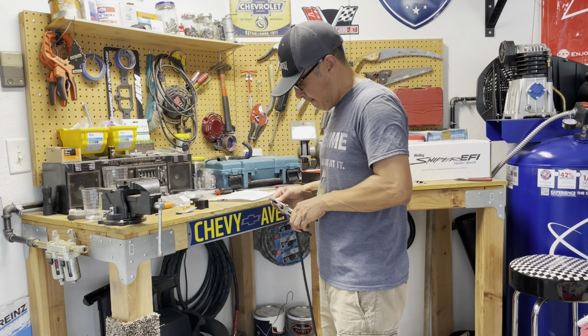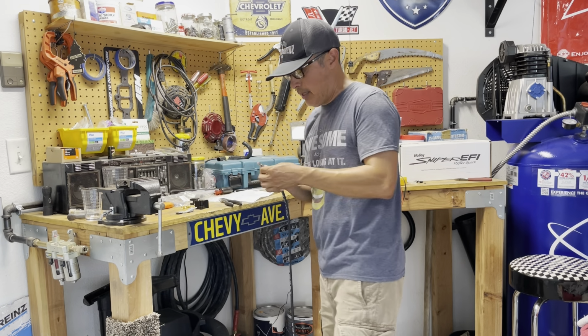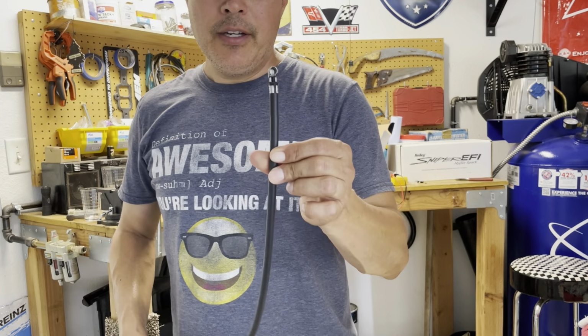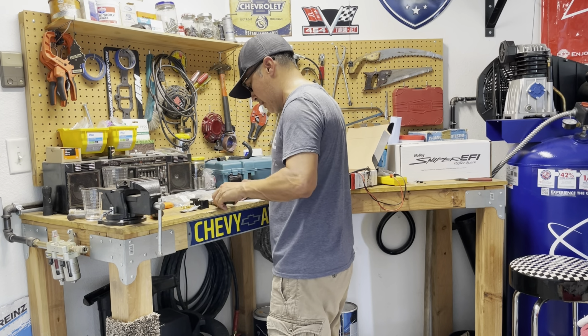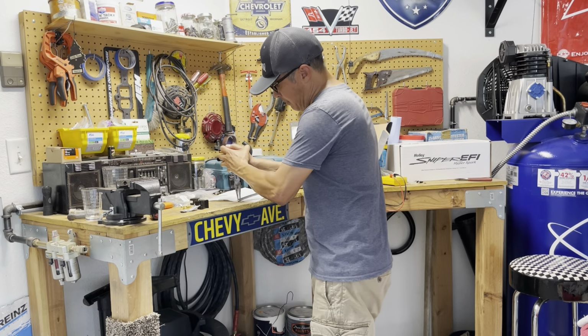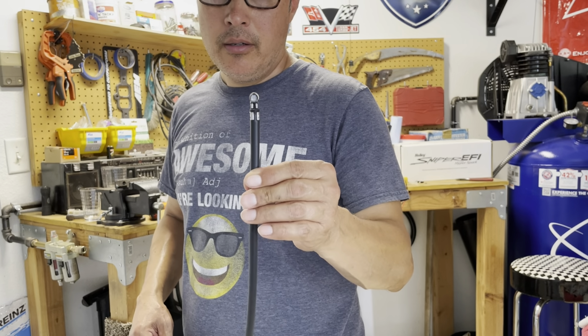I mean, you know, nothing's perfect, but I like to try to sense things up a little myself. So you take a look. You can see how it's crimped there. Now the second step in regards to this is we got to clamp this conductor in between there. So I'm just going to make sure it's pushed down with a screwdriver, and then you'll need needle nose pliers to squeeze it and clamp it together. So there we go. If you take a look, you can see it's all ready to put the boot on now.